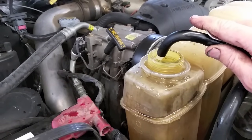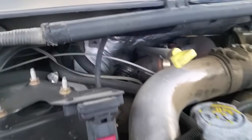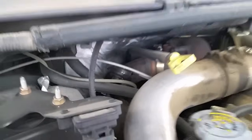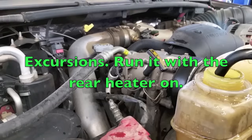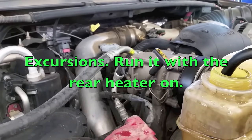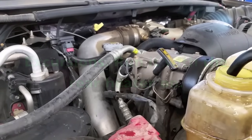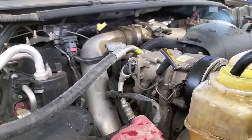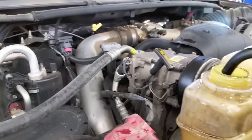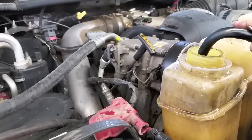I'm going to top it off the rest of the way with water. A couple things you've got to be aware of: if it's one that has a heated control valve, you need to turn the heater on. Not all units will have them — the 6.0s or the 7.3s, not all of them have the heater control valve. But if it does, the heater must be on so the water circulates through the heater core. Otherwise you just have it going through the block and you're still going to have a lot of contamination in there. I'm going to top this one off and go drive it at light throttle.